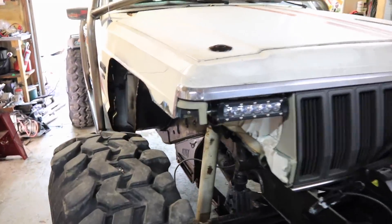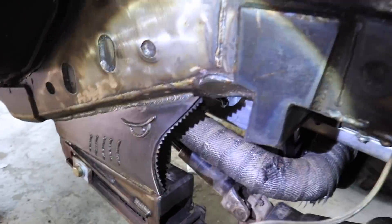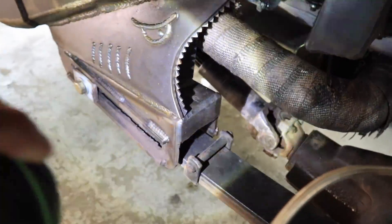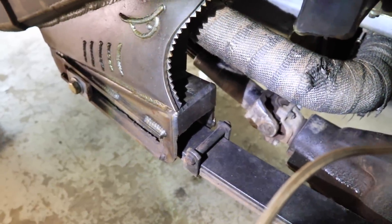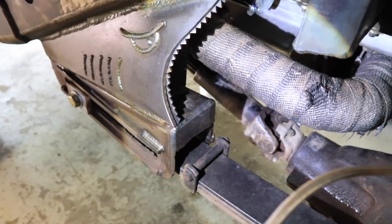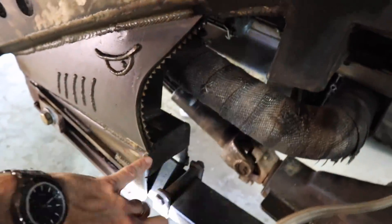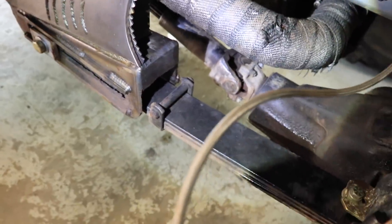The first issue I had is with these slider boxes — not necessarily an issue with the slider boxes themselves but just the clearancing. I didn't test it out properly and when I got on the trail and started wheeling I realized very quickly that the leaf spring was contacting the top of that slider box whenever it would flex. I thought I had plenty of clearance. We stopped at a KOA the first or second day in and I clearanced them out even more — turns out it still wasn't enough. Looking around at an event, everybody else is running these slider boxes completely cut all the way out with none of that box remaining, so that's what I'm going to do — cut that all out to give more room for up travel on those springs.